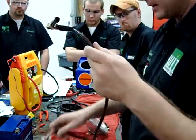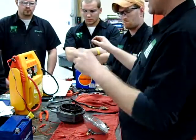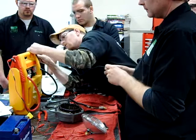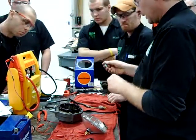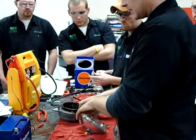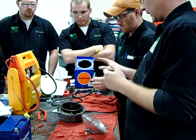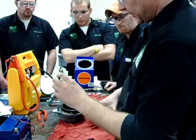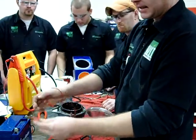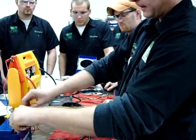Now let's take another jumper — I'm going to use these battery cables here. It doesn't have to be a super heavy gauge because we're not going to be on here all day. He's going to go to the negative of the jump pack, touch the metal, and we're going to go to one lead of the actual stator. Now, we don't know if the stator's good, by the way — this came off one of the bikes where I found it just yesterday laying under a bench. So now we're going to hook up to one of the leads on the headlight. To know that this headlight works, we went ahead and actually tested it already — you can just jump it, it's bright as hell. So it works good.